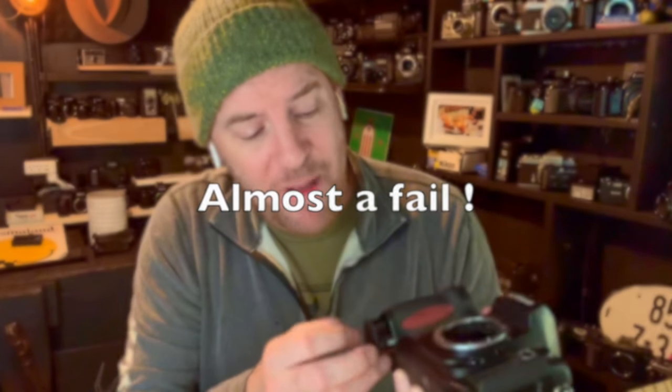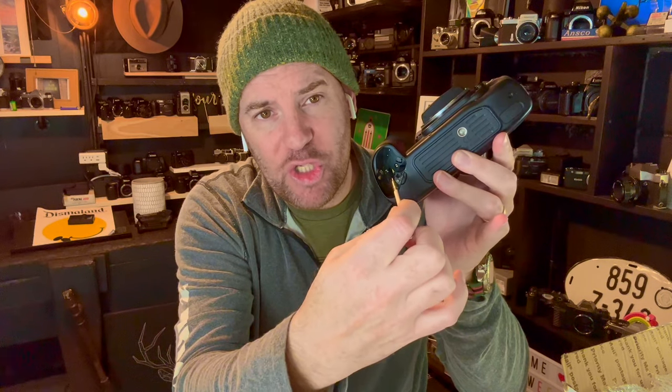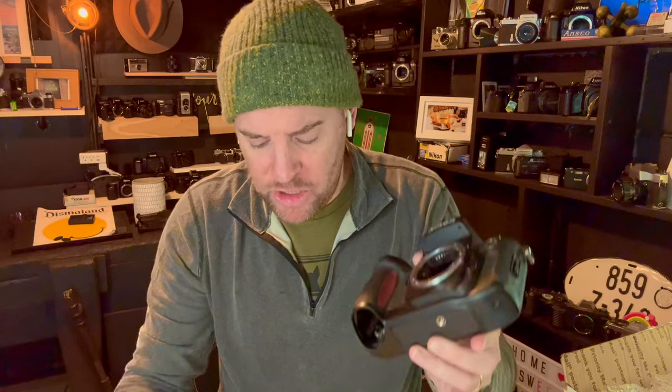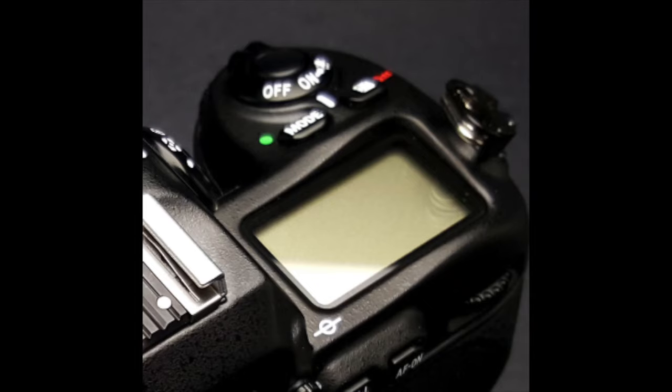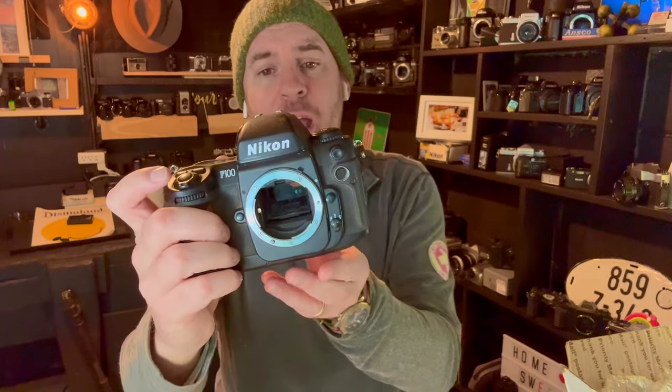Unfortunately, I didn't film what I just did because I was slightly concerned the camera didn't work — but it did. Here was the issue: whoever had this camera before had left the batteries in, just like before. I had to use a screwdriver down into the base to scratch off some oxidization on the terminals. Those three gold terminals — just use a screwdriver and scratch off that oxidization. When I popped the battery pack in, you can see on the top that she's working. There was a film in the camera — a Velvia 100 — so I shot off the last of the roll and it rewound the film for me. Now we have a fully working Nikon F100 for $41.